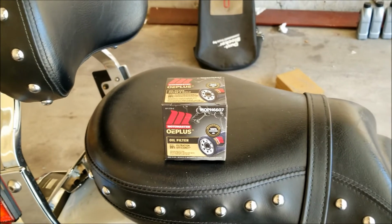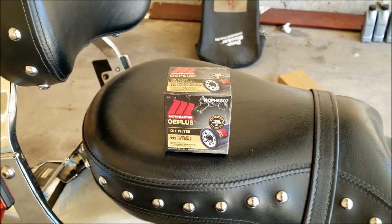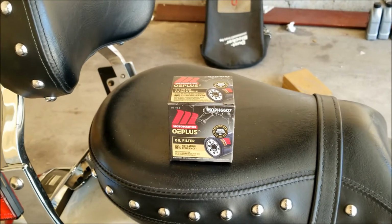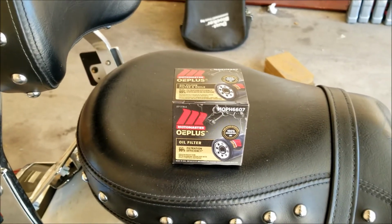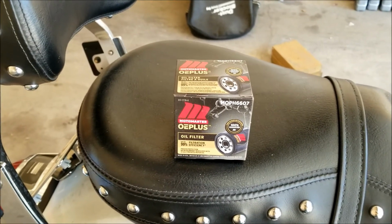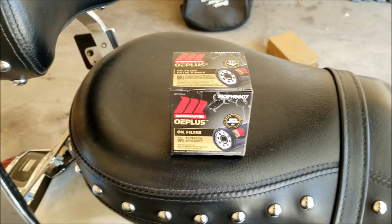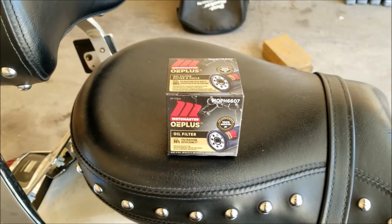So we have all the oil drained out, and the drain nuts have been reapplied back, 3 of those. The filter needs to go in there. Again, I'm not very sure on the torque spec on the filter, or if there is one at all. So I'm just going to hand tighten it to the extent I would be able to remove it later again, and not do any damage to the threads or grooves on the filter. Yeah, so let's do that, and then we can get back to filling oil.